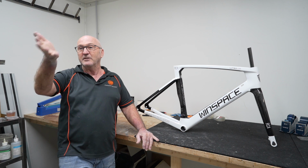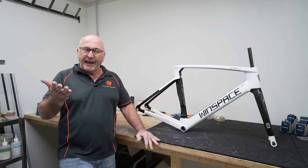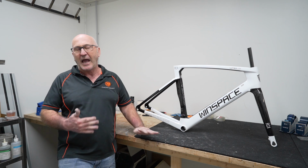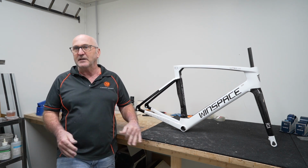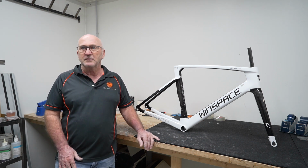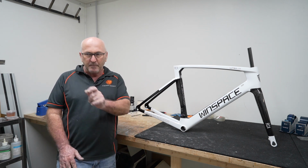Hated the decal, as we mentioned. What was that? Well, it just looked dog ugly. It was really thick. It looked like a vinyl decal that they'd put on, which we hate doing, putting on vinyl and clearing over the top. We do it from time to time on customer request to get a special effect. However, when I sanded it, it wasn't vinyl. It sanded off like it was paint or a water slide decal, but man, it was thick.